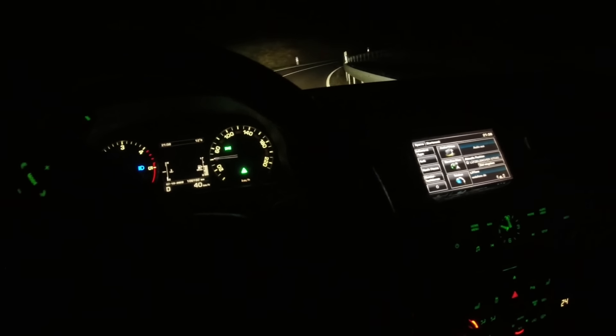I'm home now and the first thing I did is reset the adaptation values of the HP8. I didn't want to do that while still doing Autobahn driving. Look how it was always jerking when decelerating — now it's all smooth. It's beautiful and unbelievable. This car was at Land Rover before for a repair on the HP8 transmission because of an oil leak in the oil pan.